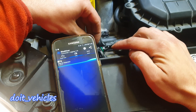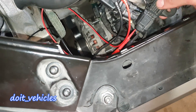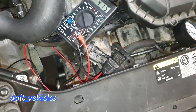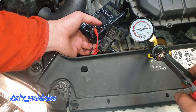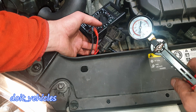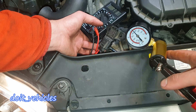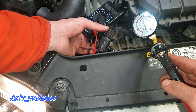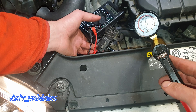If you do not have a scan tool, you can use a voltmeter. I connected wires number 1 and number 4 and I have got a value of 4.1 volts. When I increase the vacuum the voltage decreases — 3.1, then 2.3. However, this is not the best test you can do because you cannot see if there are any drops in voltage. That's usually the fault of these sensors: when the signal drops and then comes back to normal, you will not be able to read that with a voltmeter because it is slow in reading the voltage.